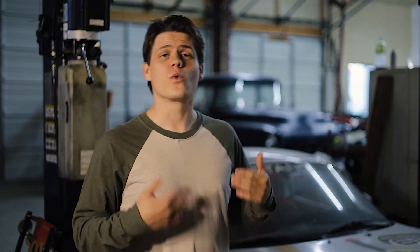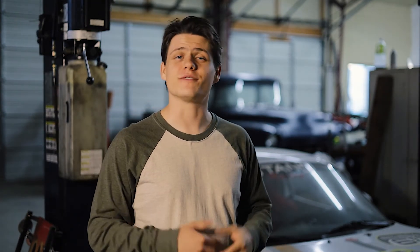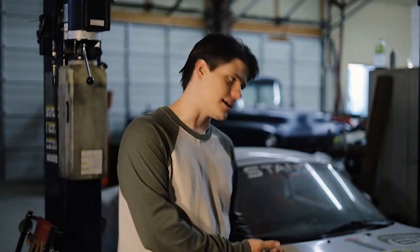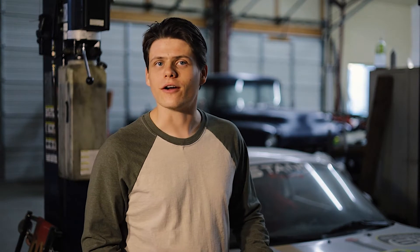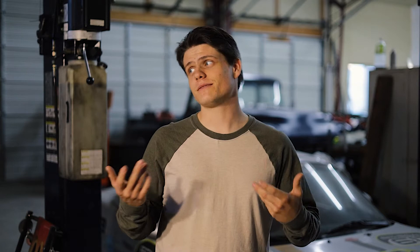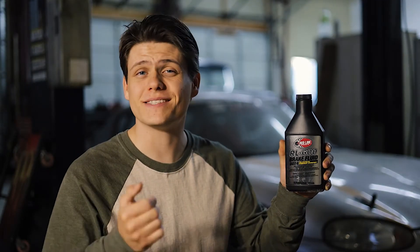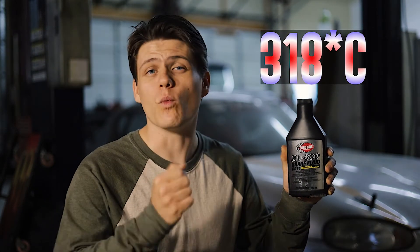As I mentioned in our last video about track days — check it out in the corner if you haven't yet — running fresh brake fluid through the race car is a vital piece of maintenance that's often overlooked, and doing it for each race is cheap insurance. Against the price of $200 a pop for tires, the cost to sign up, travel, put gas in the car, gas in the car hauler, a $12 to $15 bottle of high-quality brake fluid is not going to be the straw that breaks the camel's fiscal responsibility. This Red Line RL600 has a dry boiling point of 604°F — that's 318°C — and a wet boiling point of 400°F or 204°C.